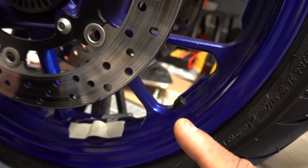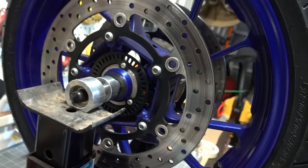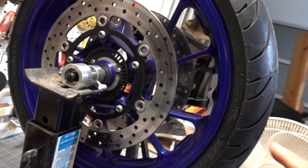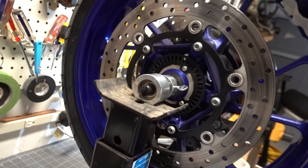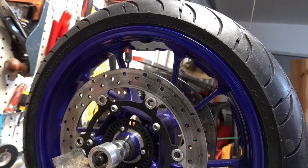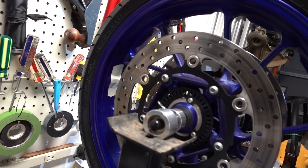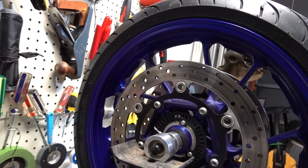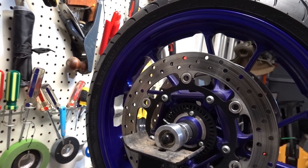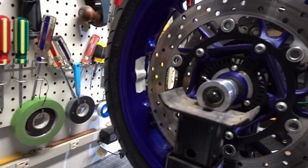My other added weight is here. What I think I'll do is put three weights right here on the opposite side to the clip-on. The weights are there, tire is not moving. Weights at 12 o'clock — tire is not moving. Weights at 9 o'clock — tire is slightly moving, but then stops. I think it's balanced. I'm going to rearrange those weights now — put all three on this side and call it a day.